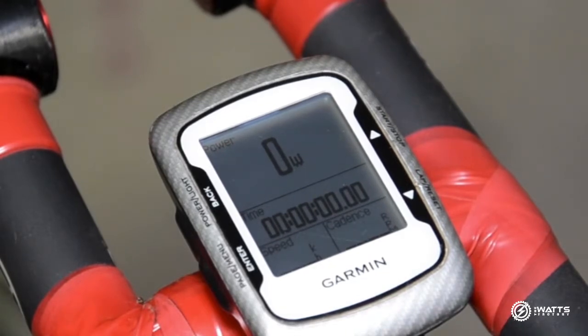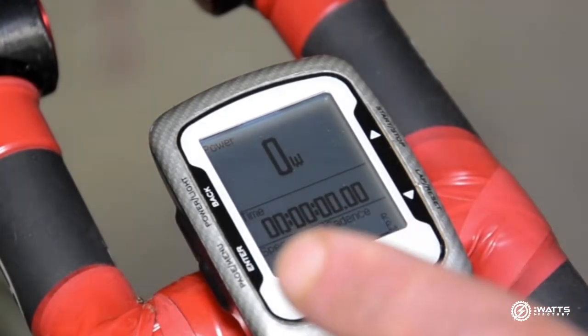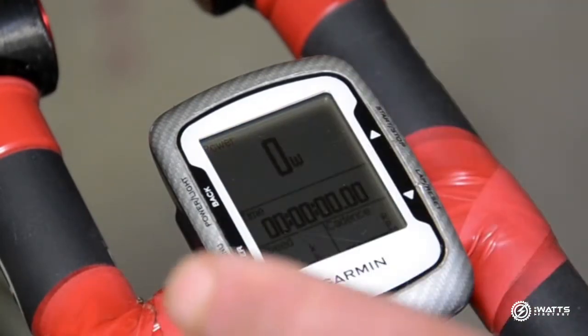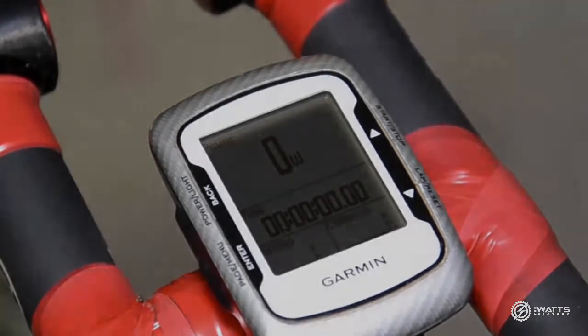It is important to remember that the zero offset number should only vary maybe plus or minus 40 points, or 40 in number. Generally, if it's drifting more than this over a period of time, there could be a reason for that. That is big fluctuations in temperature, or your crankset bolts are not done up tightly enough, and that is affecting the strain gauges within the cranks. If you're seeing bigger drifts in numbers than that, make sure that you test and make sure you torque the crankset bolts to between 10 to 12 Newton meters, depending upon the type of crank bolts you are using, and make sure that you look at the temperature difference between inside and outside of the house. Fantastic, you're ready to go and have a ride.